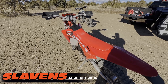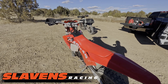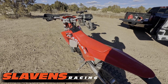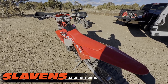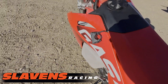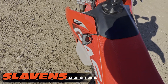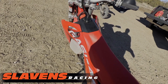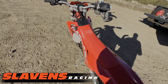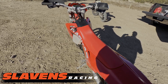This new TBI motor with the correct fueling we've done with the GET ECU really has excellent grunt. I'm really impressed with the grunt. I'm a good-sized guy and this thing is pulling me up the hills just as well as my 300 does, without revving the guts out of it — just lugging it up the hills. We've got the map switch right here, and we've got a couple of different maps available for sea level. We can also set you up with a sea level map and a high elevation map — like if you're a Colorado guy but go to Moab in the winter, we've got that set up.